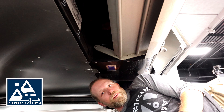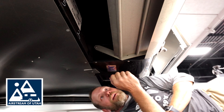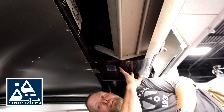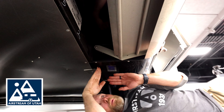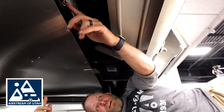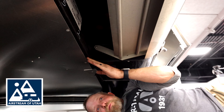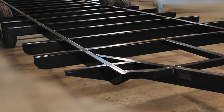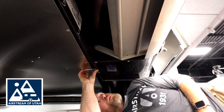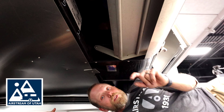Here under a traditional travel trailer, I can see the jack sticker and the jack pad. What I want you to pay attention to is where your belly pan — the aluminum part — meets the side pan. Where it changes from silver to black, right in the middle of that is where your frame rail is. This frame rail runs all the way down the length of the trailer, and that's where this jack point is pushing against the frame rail. So if it's not exactly centered or is twisted somehow and you don't get right on the frame rail, it could slip off — which is why I say use the little wood block.